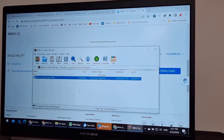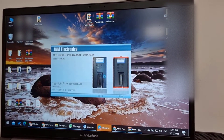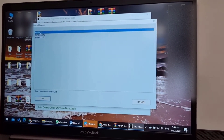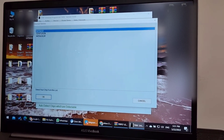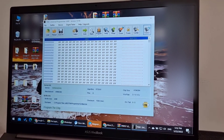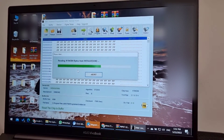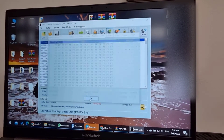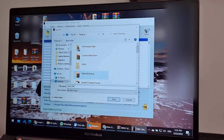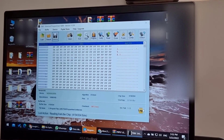I will open and unzip this ROM file, then run my programmer software. First I should detect the BIOS chip, which is correctly identified as Winbond 25Q32. Before I start programming the chip, I will read it first to make a backup of the current chip contents, in case anything goes wrong.